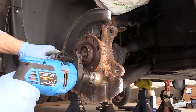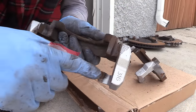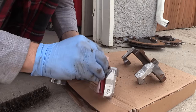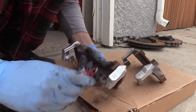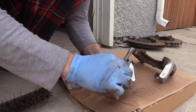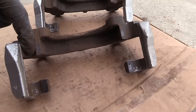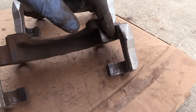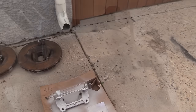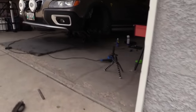Cleaning the hub with a wire brush on a drill makes it fast and easy. Next step is to clean the areas where the brake pads actually slide — using sandpaper and taking my time to thoroughly clean the area. Once completed, those places are smooth so the brake pads will slide freely. I also gave the brackets a few coats of paint.